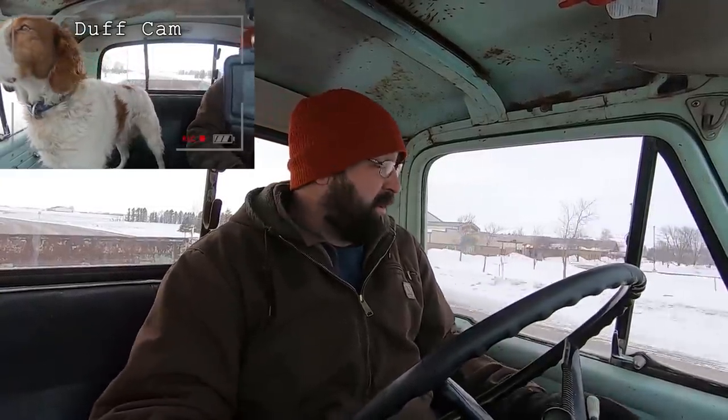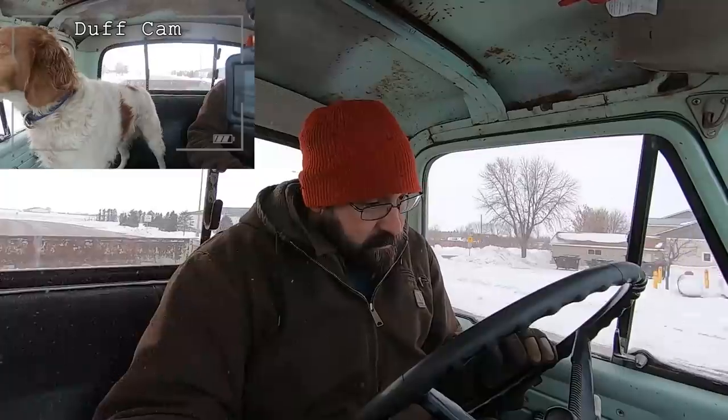Yeah, you can do like 30 miles an hour in first gear in this thing. Temp gauge says 160, so she warmed up nice. Turn the defrost on, but really all it does is make a bunch of noise. I don't know if the heater core is bad, or if that blower motor is in there backwards, but it seems like it's moving air. Tailgate latch leaves a bit to be desired, mainly the design, and partly because it's bowed and screwed up, so that might just drop open on us, because that's what happened on the second test drive.